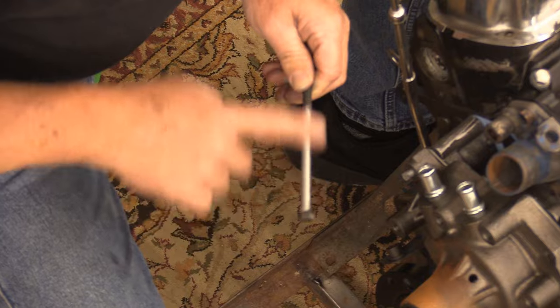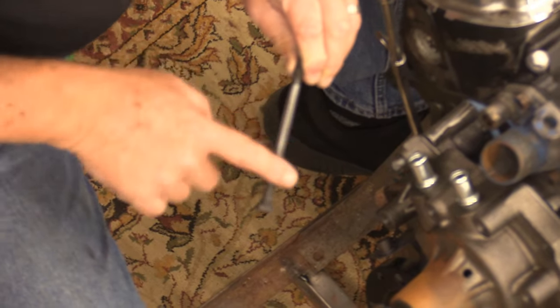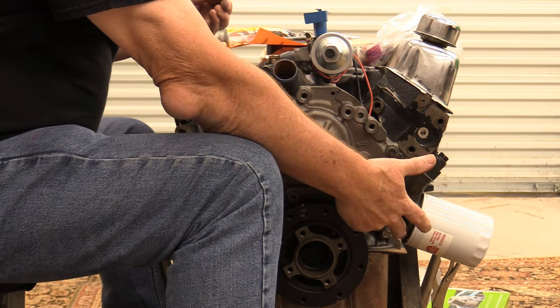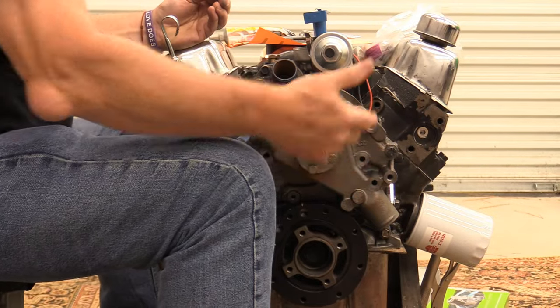This water pump is not the one I thought it was. When we ordered it we ordered a water pump for a 1970 to 1973. We wanted our inlet on one side of the engine and our outlet on the other side because the cross-flow tends to work a little bit better for driving around. Ford went to that in 1970 — they learned some lessons from the earlier cars.